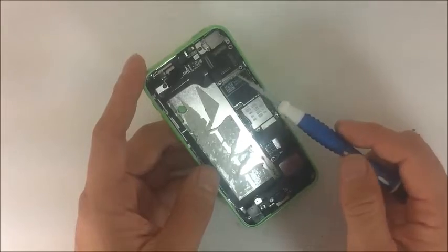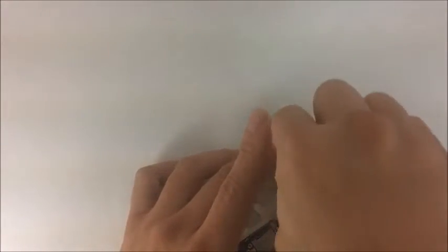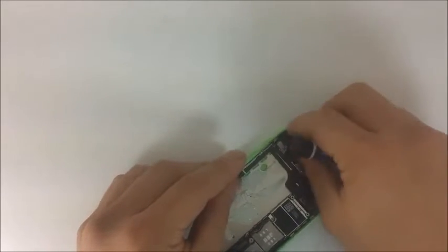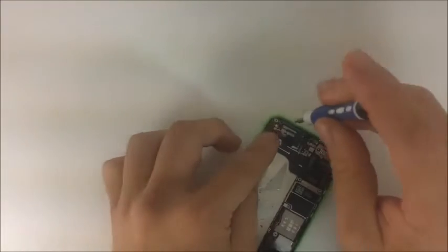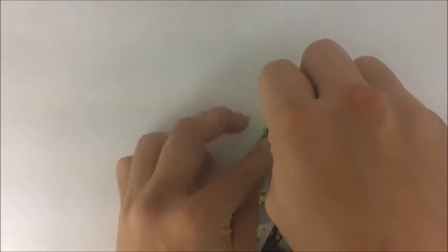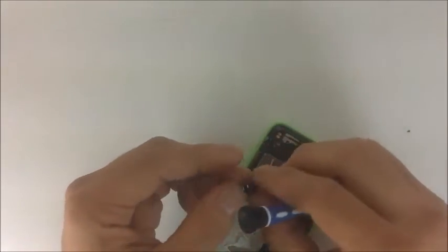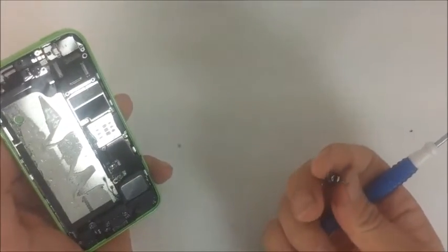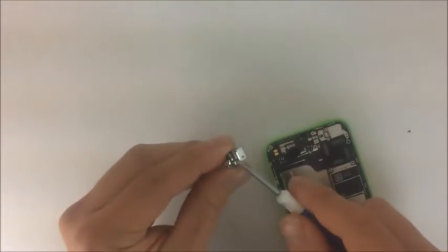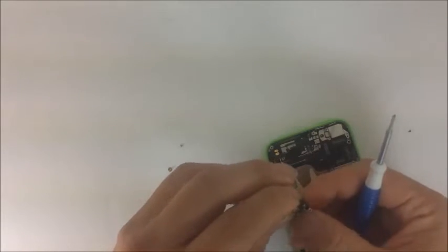Here you also have the vibrator, right here on the top left. All of these can be removed — let me go ahead and disassemble most of it. There's the vibrator right here; it can be removed, just be careful with it. It's also attached here on the top left as well. If a phone's vibrator stops working — assuming there's nothing wrong with the software — then you know that's what needs to be replaced. This component is also connected with two metal pads and two prongs. If the prongs are pushed down too hard and lose their flexibility to connect to the metal pad, you can just stretch them back out — that's a very common issue.